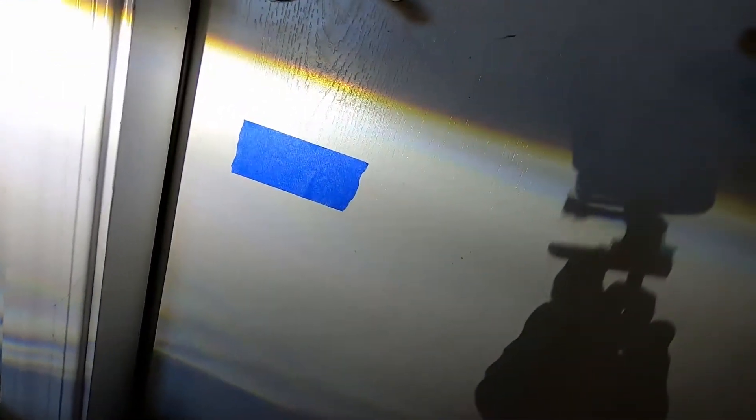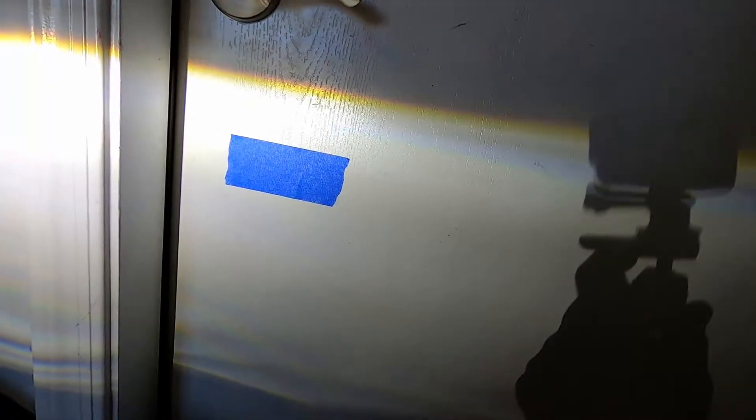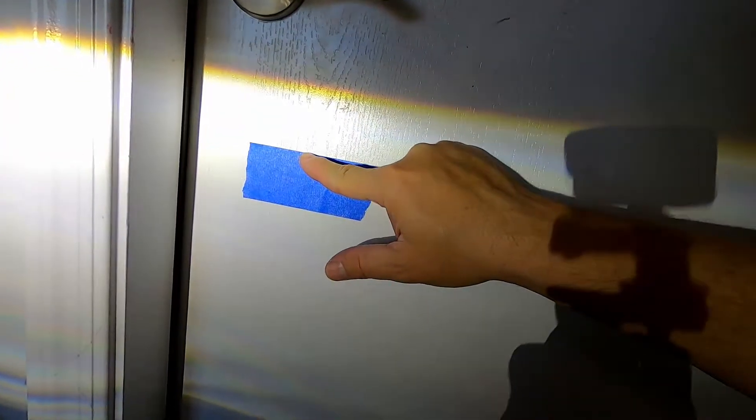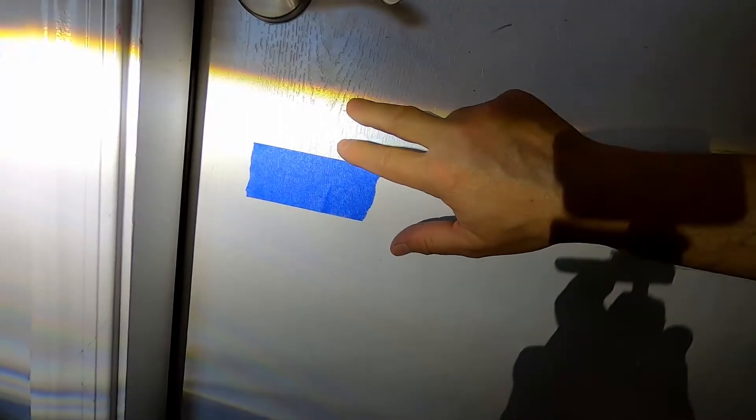The positioning is about — I'm about 42 inches, or three and a half feet, away from the headlamp to the wall here. I started at the top of this blue tape, and I've raised it about two inches, so I'll have to drive it at night to see what kind of difference it makes.